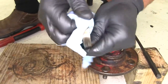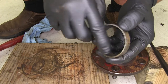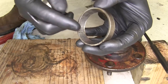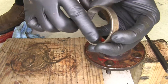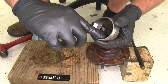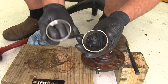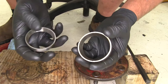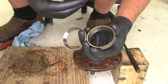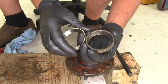There you can see our old race. Let's wipe this off and take a look at the symptoms that cause us to need a replacement. You can see all the marks and grooves around the outside edge — there's even some cracking from excess heat. We probably had a bearing failure: some material got in between the bearing and the race and caused all this damage. As your bearing rides on that, it drastically decreases its life. A nice smooth surface extends the life and makes our bearing last much longer. It's a great idea to replace your races if you see any issues like this. This also works great for a low-budget hub rebuild, and replacement races come in handy when your hub has gone obsolete and a complete replacement isn't available — you can still get the components to rebuild it and extend the life of your trailer.